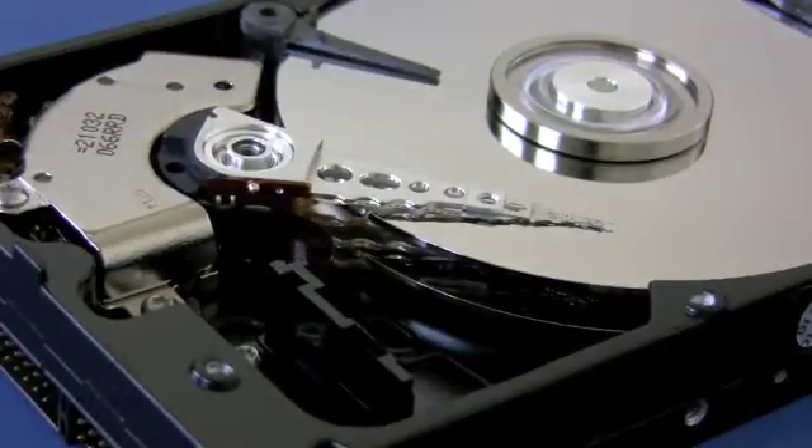This is the typical click you hear at the beginning of the drive. If the drive continues to click several times, that means there's a serious problem with the head stack assembly, because typically — like here — it should just be waiting for commands to operate on the drive.